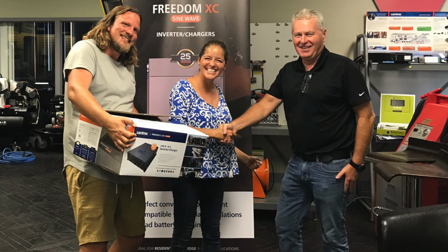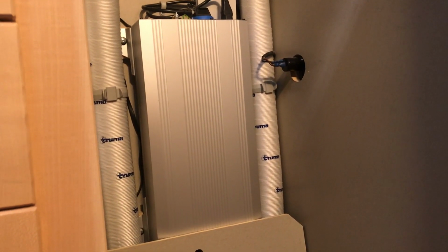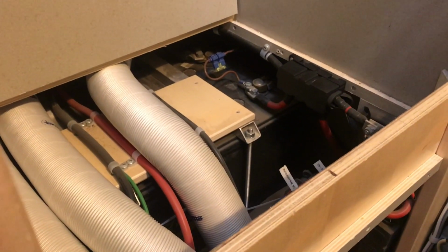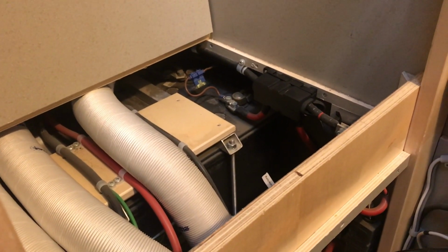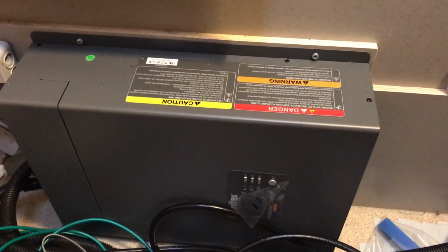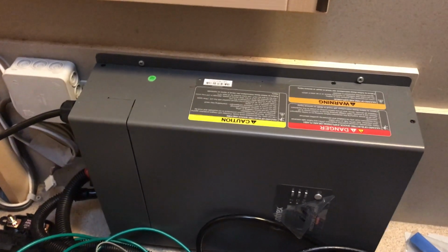That's our closet. We're in our truck. Today we are going to install an extra inverter. This is our old inverter. It's a 230 inverter. Here's our battery setup. It's right in here. It's 12 volt batteries, 410 amp hours. And that was the space for our old air conditioner. This broke on us, and now here in America we couldn't find anything, so that's why we thought it's time for a 110 converter, and there it is.